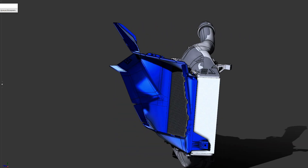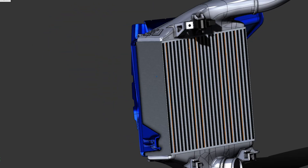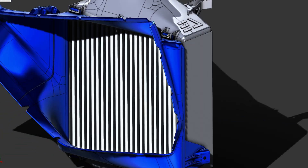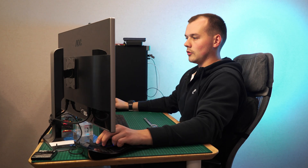This is how we're going to solve the first issue — with it being susceptible to rocks. We'll be fitting protective corrugation to the front and to the rear surface of the intercooler. Those protective fins are 0.3mm thick, while the primary fins that'll be dissipating the heat as air passes through are 0.1mm thick.